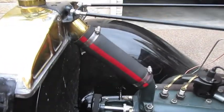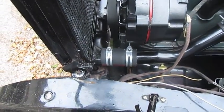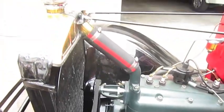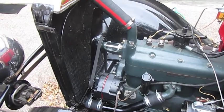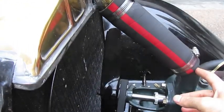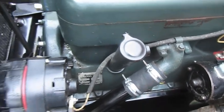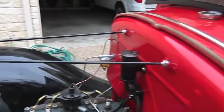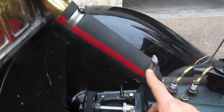This is a good time to put brand new hoses on the Model A. If your hoses look slightly cracked, old hoses are cheap and it's hard to get at these things when it's all bolted together. So when you're doing any radiator work, go ahead and put all new hoses on. When putting the top hose on, apply a little bit of grease on each end to make it slide in better — not a lot, just a little. Then put these two rods that hold the radiator in place, and tighten down all the hose clamps.